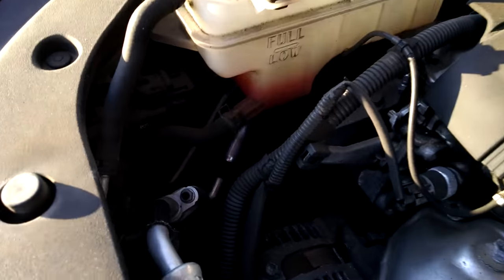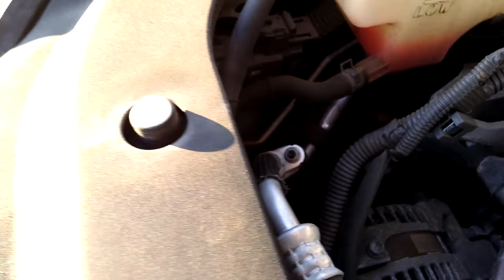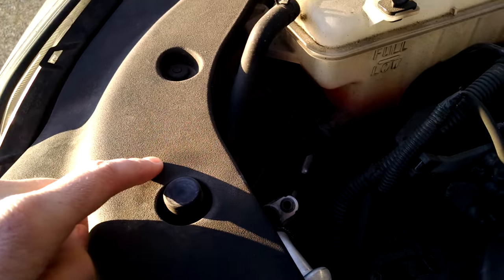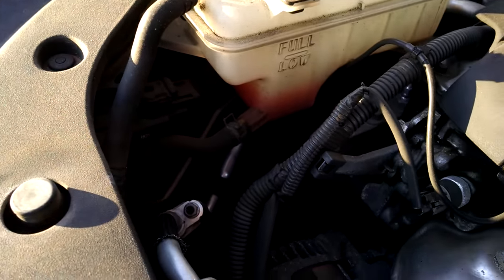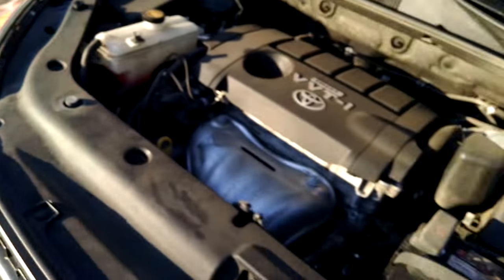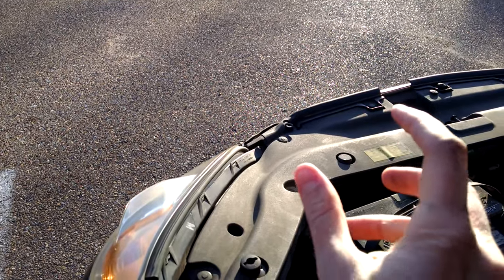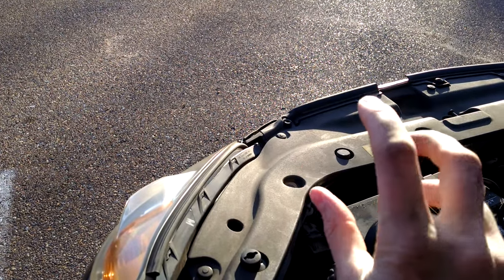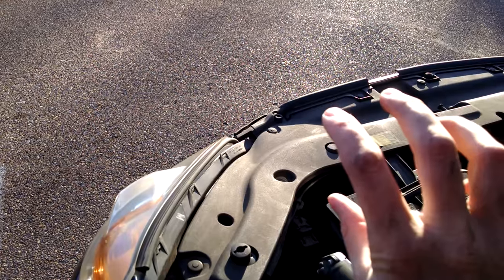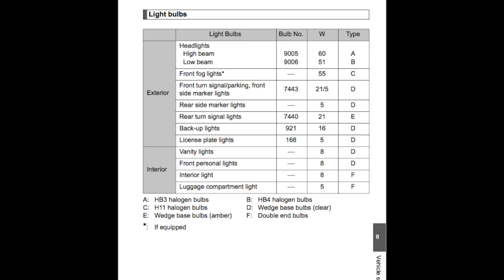I'm on the right side of the car — you've got the same thing, it's just a little bit of a tighter squeeze. So this one you might find that you need to take this cover off to get to it. But it's the same process: think like you're facing towards the front of the car, grab the back of it and twist counterclockwise, and then just pull it backwards. That's all there is to it.